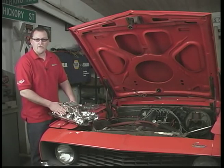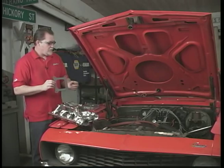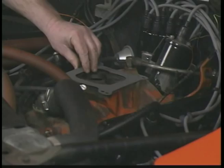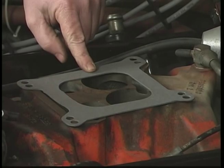Now we're ready to install our new carburetor. Take note of something first though: Edelbrock carburetors are what they call a square bore carburetor. What we took off was a Quadrajet carburetor, which is a spread bore. If we try and just install our new carburetor with just a standard gasket, you can see clearly right here we're going to have vacuum problems, and that this gasket does not fit this intake manifold.